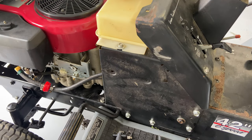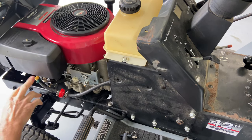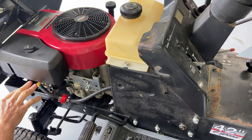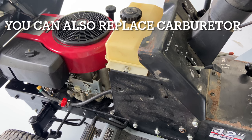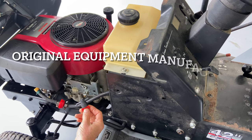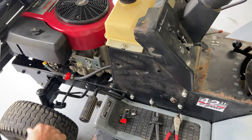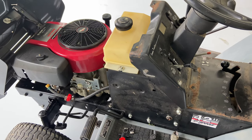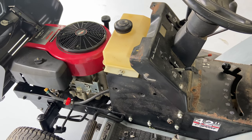That pretty much sums it up for this video on how to fix the problem of gas in your engine — it was because the needle valve and seat in the carburetor did not do their job, usually due to dirt contamination. Replace the seat and needle valve correctly and you're good to go for a long time. Putting in an inline fuel shutoff is also extra protection — when you put the machine away, you can turn the fuel off and that will keep any carburetor problems to a bare minimum as far as having all the gas go from the tank into your engine. If you like this video, please give it a thumbs up, please subscribe, tell all your friends, and I'll catch you on the next one.